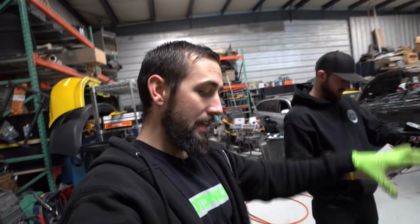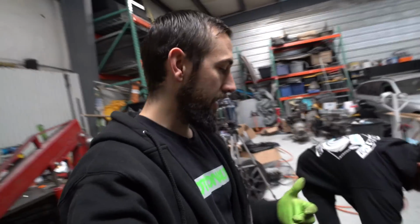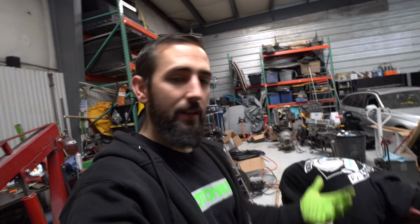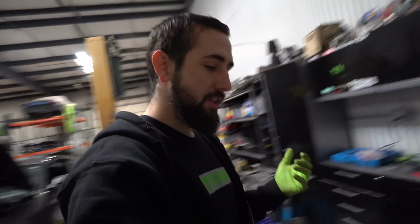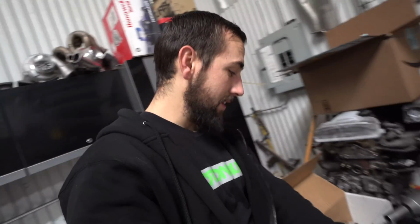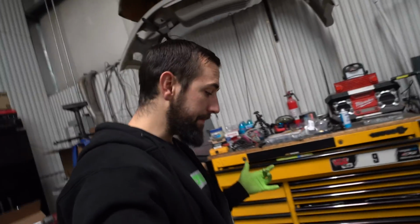So that's one of the downfalls about this Mustang chassis, is having a returnless fuel system, especially getting multiple pumps to hang in the tank in a decent configuration. One of the things that I was going to do just to make it work is I ordered a super cheap fitting. This is basically a bulkhead 6 AN fitting, and I was just going to drill a hole in the top of it and return it that way. But Deatschwerks hooked it up, and I'm really excited about that.